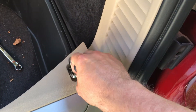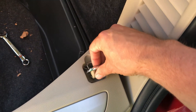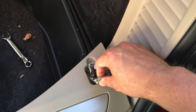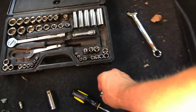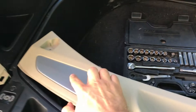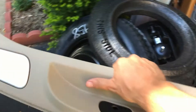The first thing is these little hooks. You're going to want to use a screwdriver and carefully just pop up the top of it, and the top will pop up like this and it'll expose a screw. You'll unscrew this and do the same thing to the other side. Unscrewing this one, unscrewing this one, I was able to pop this out and just slip that aside.